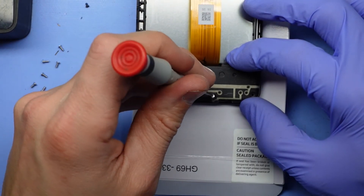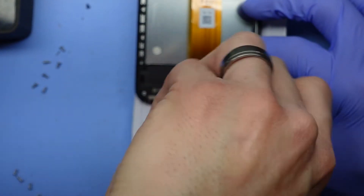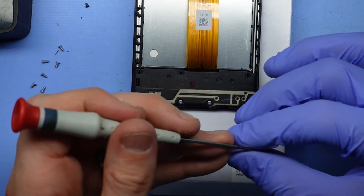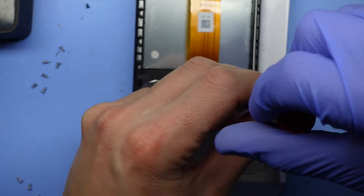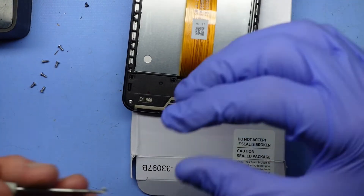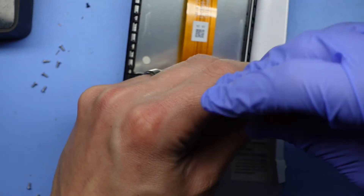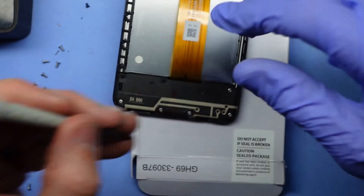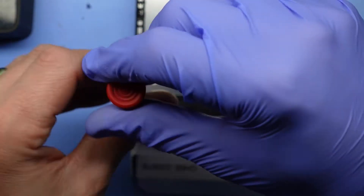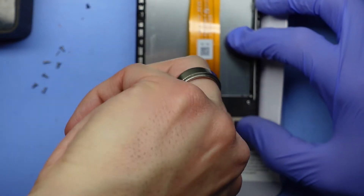Now, if you're not buying the service pack it's going to be considerably more steps just to replace the display. I typically only buy the display as a service pack as I find the price to be reasonable in my region, and then I don't have to deal with any dud screens or faulty screens. I think I had one dud screen out of probably about 50 or more, so I'm perfectly happy with that failure rate.